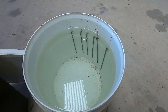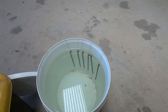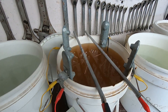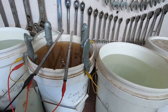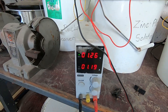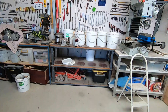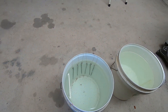It's about 10 minutes later and the fizzing has settled down on those, so we'll whip them out and put them over in the plating bath. We've hung them in the plating bath. We've done the math on those, and at 0.14 amps per square inch, we've got that set to about 1.2 amps. We'll give them about 15 minutes in there and see how they look. While those ones are cooking, we'll put another half dozen or so in the acid pickle — eat, sleep, repeat.